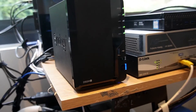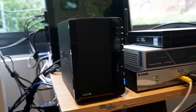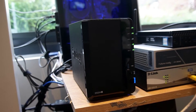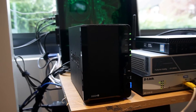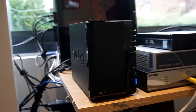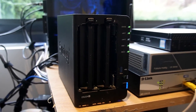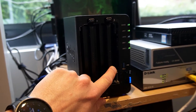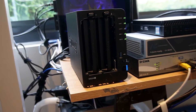For file storage, I'm running a Synology DS224 Plus — this is a two-drive NAS. I've got two six-terabyte drives at the moment, so just enough for what I need. Most of my content, the archives for the YouTube videos and other stuff I need to store, lives on this box. It's running in RAID 1, which is mirroring — one drive stores all the content and it's automatically mirrored onto the second one, so I've always got a second copy if one drive fails. There are also automated backups that go into Google Cloud and Microsoft Azure.